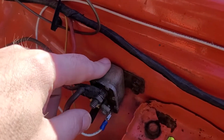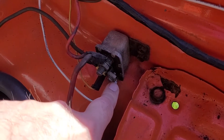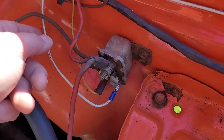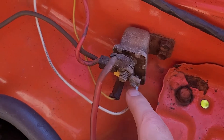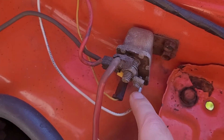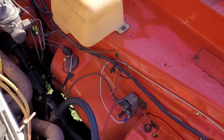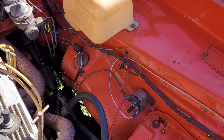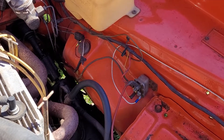Really simple thing. From the starter relay, you have this corner lug. All you got to do is run a wire to a common ground. Once again, wire on the corner lug to a common ground. Maybe this will help you troubleshoot a bad wire or something to the neutral safety switch on the side of the transmission, or some other issue.